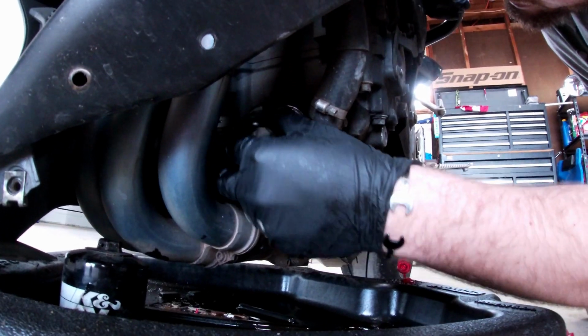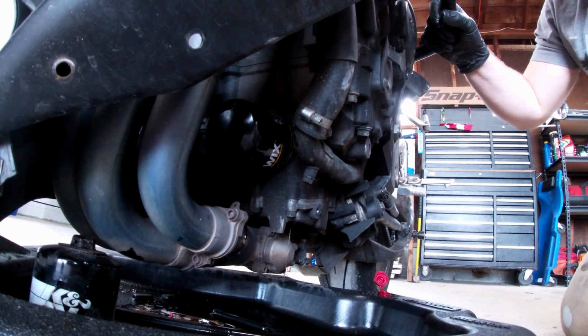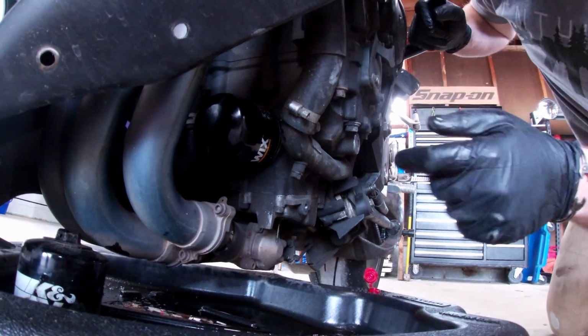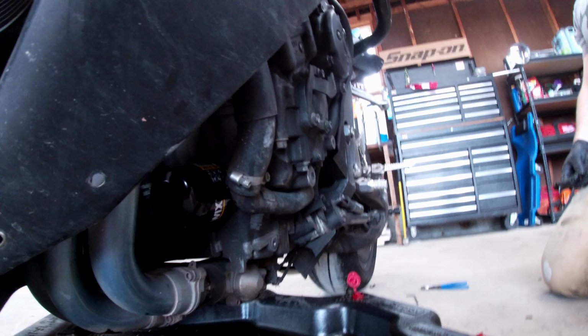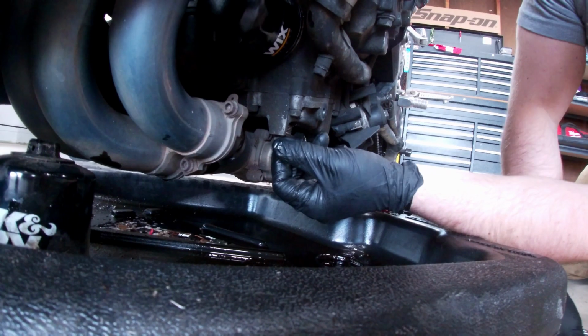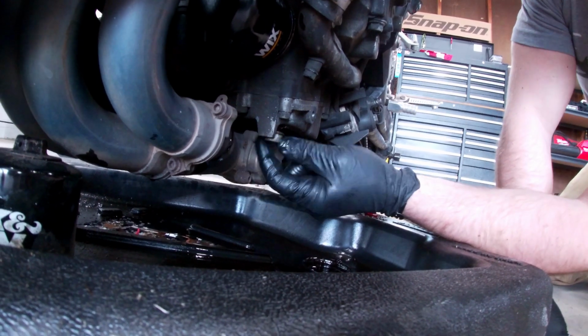You'll be cleaning your whole bike down. Oil filters are safe hand tight, because heat, expansion, contraction, and pressure will seal it. You hit all the buzzwords on that one. Not suction, but okay. All I have here is my half inch drive. It's not less than 15.